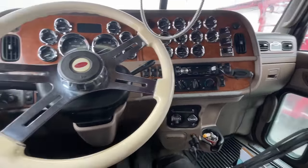I will show you what that neutral gear is. We'll try dropping a gear and try to catch the next gear lower, but I'll intentionally stop short. I won't give it enough fuel, so it'll pop out of the 18th gear, I guess, but it won't exactly go into the 17th gear, and the revs will drop into this neutral zone while you're still in the gear. Whoops. Nope. Hold on. Nope. All right. This time for sure. You don't want to leave it in that neutral zone for too long, because it's bad for the transmission.